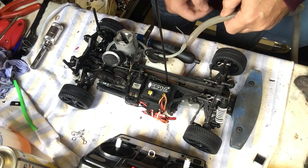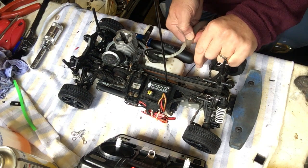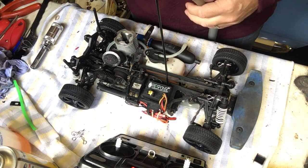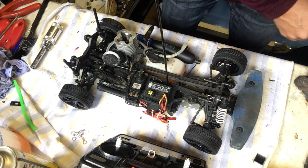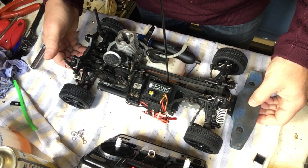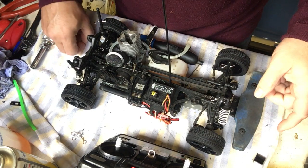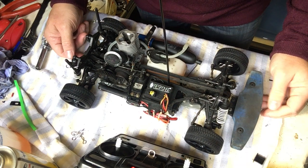I'm going to squeeze the exhaust to stop the engine. Just to show you — I'll squeeze the exhaust here to stop the engine; that chokes the engine and makes it stop. It's a new engine, it's just been rebuilt, so you probably heard it stutter a little bit there, but it will be fine — it just needs to be run a little bit. I'll also go through the car before it gets sent out and make sure everything's free, because it feels a little tight. It's been a long time since this car has been run so it probably needs a good run to loosen it up.